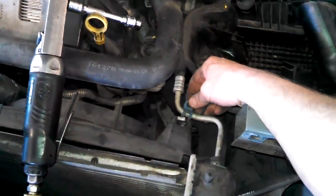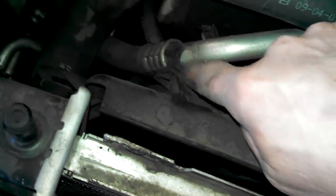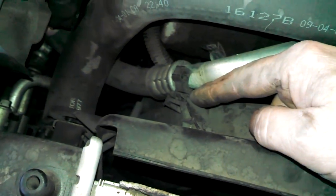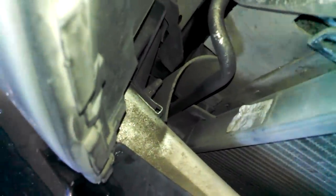So we have a 10 millimeter bolt out of this bracket here, 10 millimeter bolt out of here for the cooling fans. Use a screwdriver and pry these out — you can see it's got a little finger in there, kind of tough, it fits in this hole. Two of them right here. There are several ways to pull them out — you can also pull this piece and separate it, or maybe even right out from the fan. Got this 10 millimeter bolt out right here, now the fan is loose. I was able to lift this up and slide it out of the slot down there, so it's free on both ends.